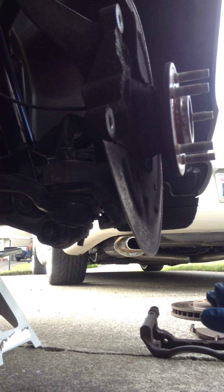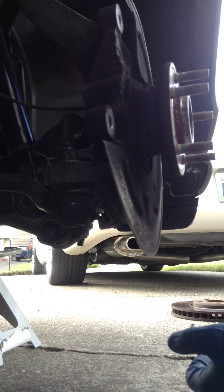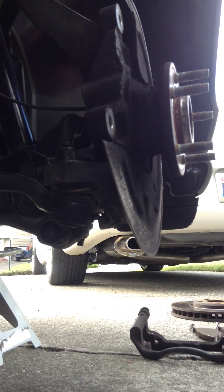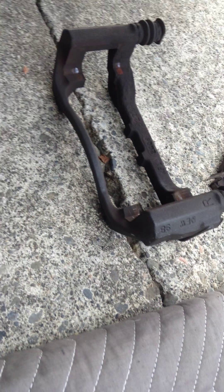I'm going to pause and edit this video together, then move on to the next step. This is also a perfect time to paint the calipers. I'm going to give this part of the caliper a decent cleaning and spray paint it gold — like the gold caliper on my motorcycle. I think it'll look pretty nice; I've already done the other side. Once I paint the dust shield and caliper, you're going to want to mask off the pistons. You really only need to paint the top and sides that you can actually see.